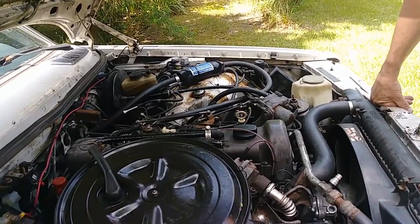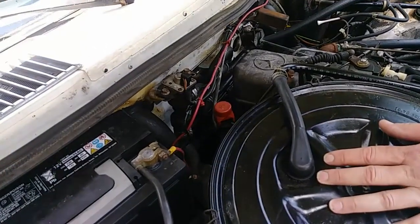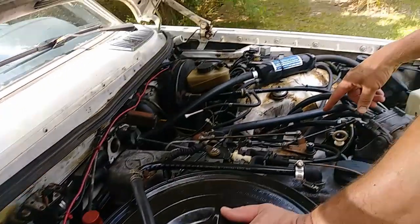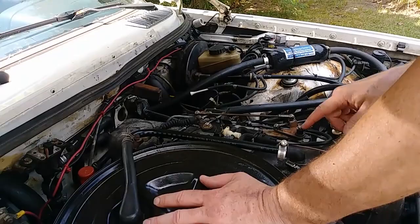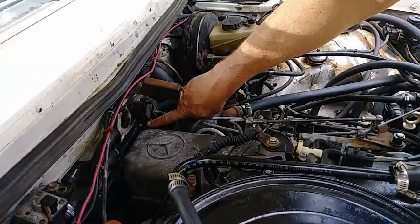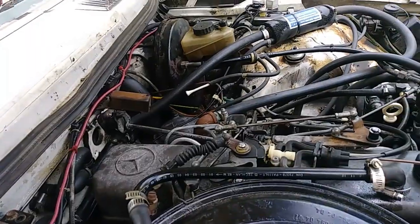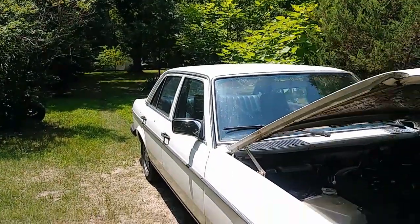My next project is to put my valve in — the heater valve. It doesn't run hot inside, but it defaults to just slightly open with this factory heater valve. I'm not worried about it right now. I purged the air system out, got the fuel filters on. It runs a little bit better since I oiled up all these linkages — this shaft, that shaft, and the one going up here and the one under the pedal. It came out nice.